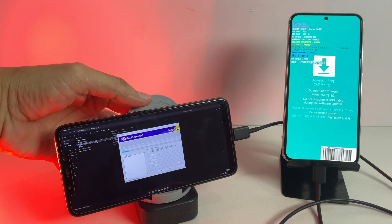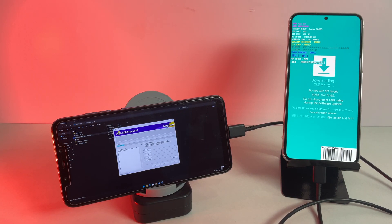To root your Samsung phone, first open Odin on your Windows phone. Inside Odin, select the TWRP recovery file in the AP slot, and the VB meta file in the userdata slot. If you see the blue slot in Odin, it means your phone is successfully connected. Make sure to uncheck the auto-reboot option in Odin's settings. Once everything is set up, click the start button to flash TWRP onto your Samsung phone. As you can see, TWRP is now flashing on my Samsung phone using the Windows phone.